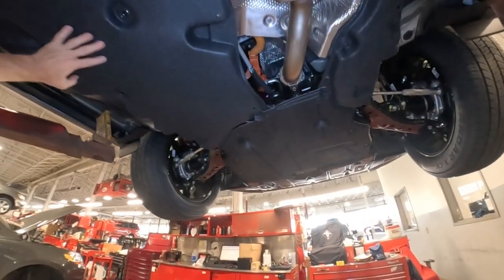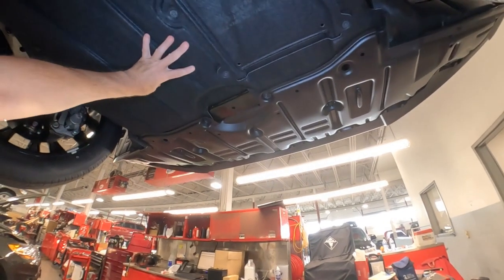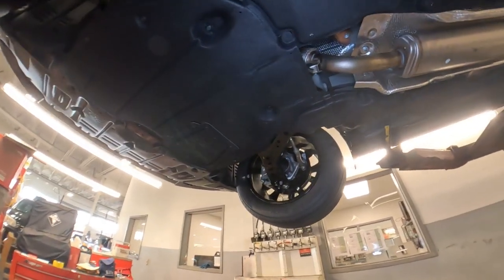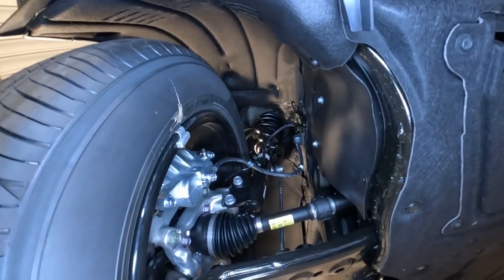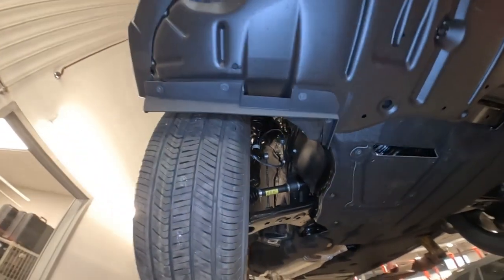Around that 10-year mark you might hear that more. There's more of that felt covering going all the way up under the transaxle here, again to reduce road noise and protect the undercarriage from debris. Here's your front suspension — you can see it's a McPherson strut with a coil spring way up on top of that strut. It's fully independent front suspension.